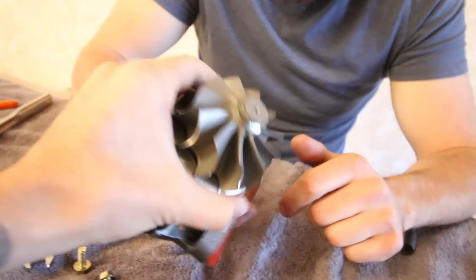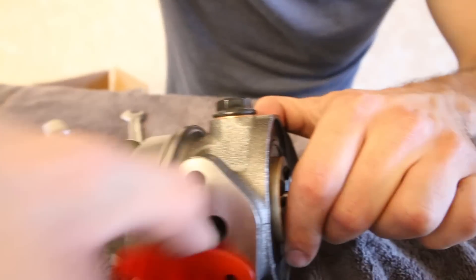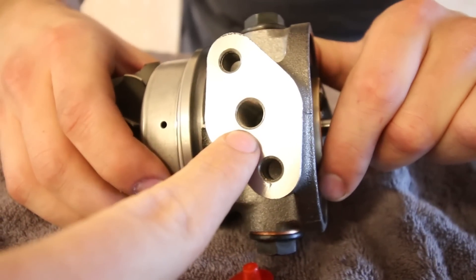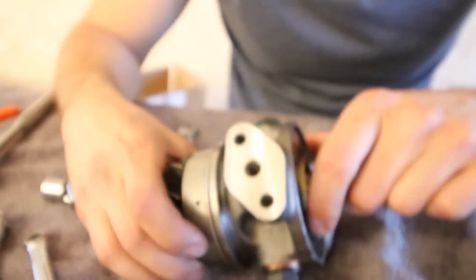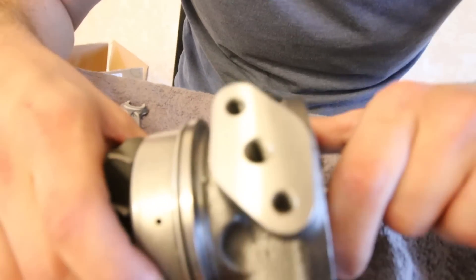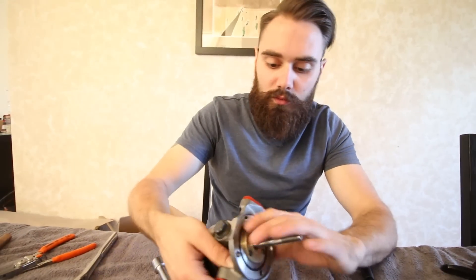The first indication that something was wrong was that if you look at the inlet side here, on a real ball-bearing turbo there's a pin in there, and that's where your restrictor or your oil feed would go. In this one there's nothing, because this center housing is made for journal bearings. There's no pin to pull out, there's no pin to press in, so there's not a real dual ball-bearing cage in there. It's this weird kind of hybrid turbo.